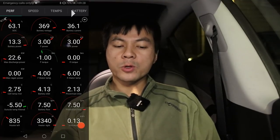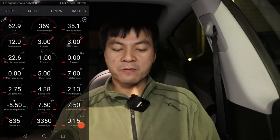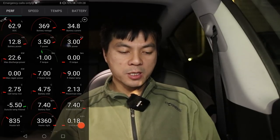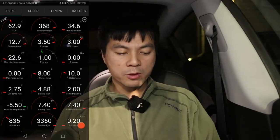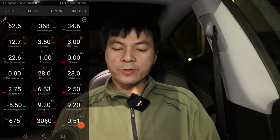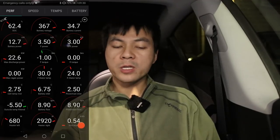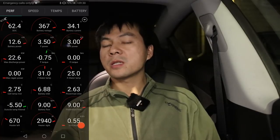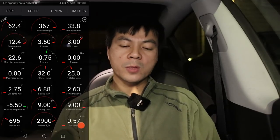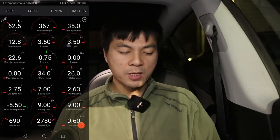So you can see what to expect in the worst case: a really cold battery and cold cabin — probably minus 5 in the cabin too. It will suck around 13 to 13.5 kilowatt. This also means that if you have 11 kilowatt in the plug and need to preheat and charge, the car cannot do it all from the plug — it will have to pull a little from the battery, as we saw in the first case.